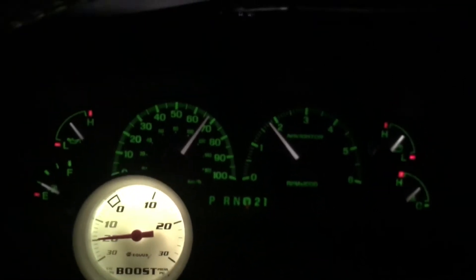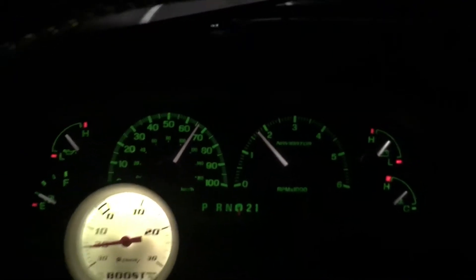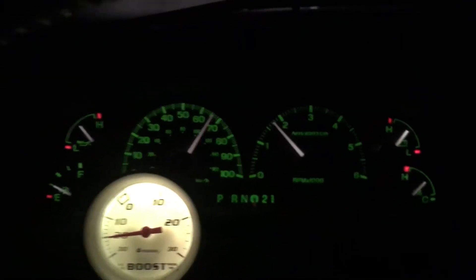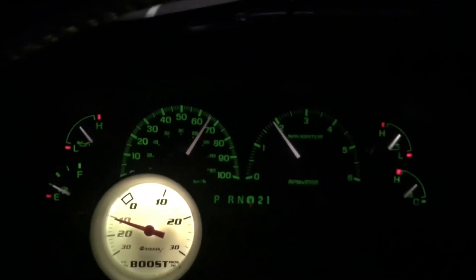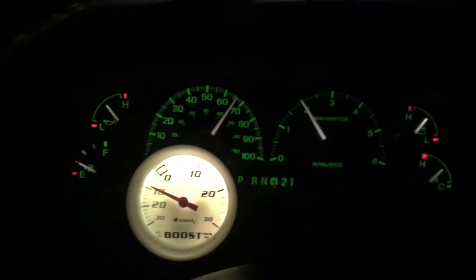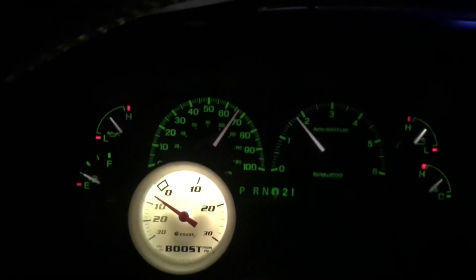Hello, Driving Intelligence. At 208,000 miles, I did a valve body rebuild and I also made several other changes, including shift accumulators, shift solenoids, EPC solenoid. I now have almost 220,000 miles on this truck.